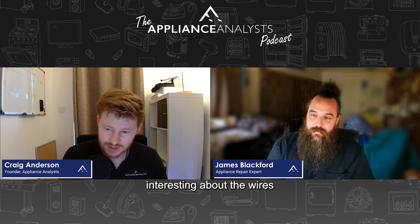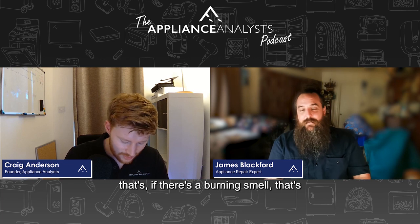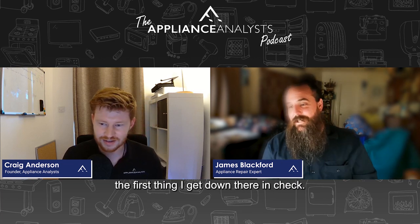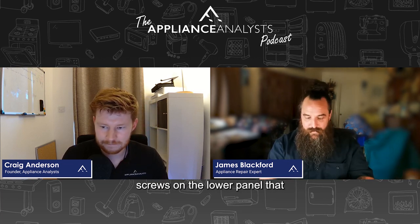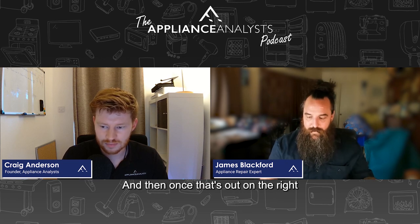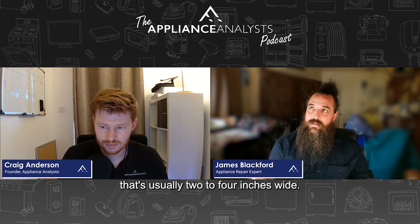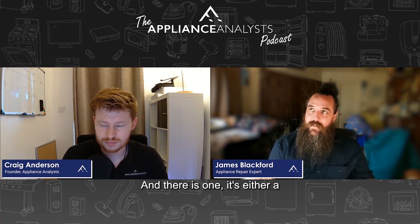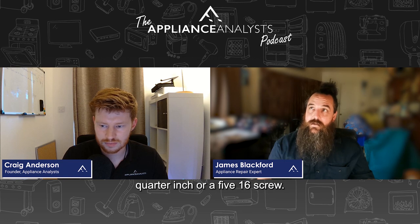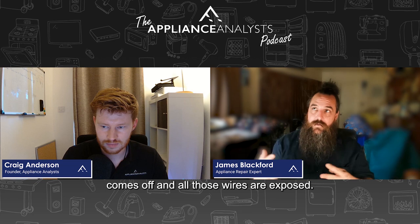Yeah, that's super interesting with the wires though. Good to know. If there's a burning smell, that's the first thing I get down there and check. Usually there's two screws on the lower panel that covers the bottom of the dishwasher. And once that's out, on the right-hand side is a small gray metal box that's usually 2 to 4 inches wide, a couple inches deep. There is one screw, either a quarter inch or a 5/16. Once you remove the screw, the cover comes off and all those wires are exposed.